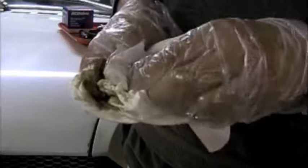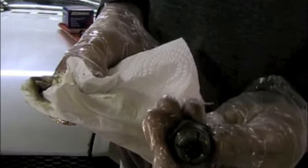Use the time that the oil is draining to clean the grit and grime out of the threads on the drain plug. Now is also the time to use the 10mm socket and ratchet to snug up those bolts that hold the oil pan to the engine — they always seem to work their way loose and they're a major source of oil leaks.